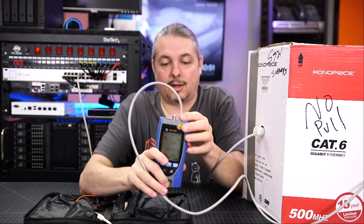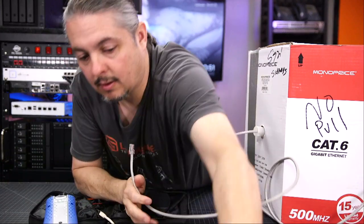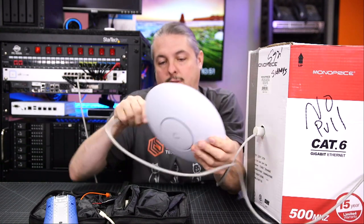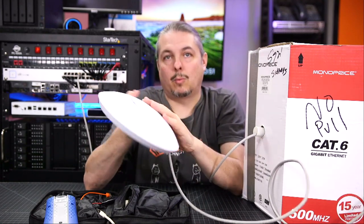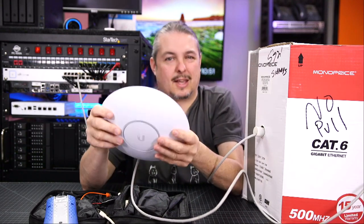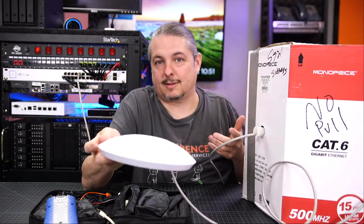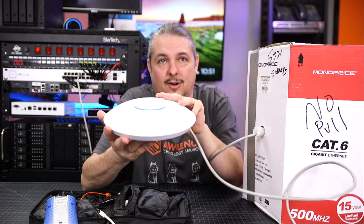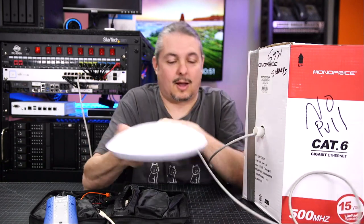This is the max load — not what the UniFi device I'm going to plug in actually uses. This is just a standard UniFi access point, a UniFi HD. We can see it working. One thing to point out: when using a standard HD, it doesn't go much over 10-12 watts. So this cable — despite being too long, despite exceeding the recommended length as we discussed with Dan — some cables can go a little over length. You can see it's lighting up and adopted. Worked fine even with that.